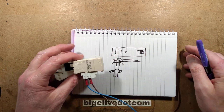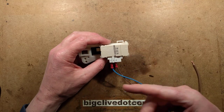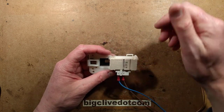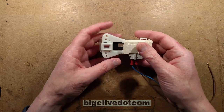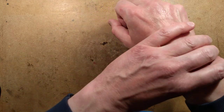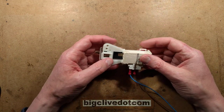The thermal mechanism is very clever. The point of it is that if a washing machine is spinning at full speed - like 1,200 RPM - and it was just a solenoid lock and you turned it off at the wall, it would still be spinning. A solenoid lock would just unlock instantly and you could open the door. If you stuck your hand in and the clothes snagged round your wrist, it could actually break your wrist. That's happened in the past - kids have put their hands into spinning machines and been injured.